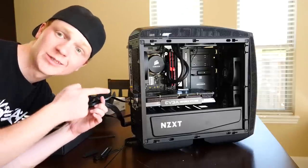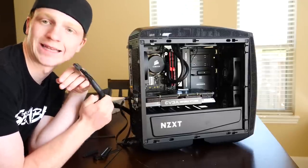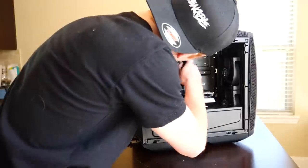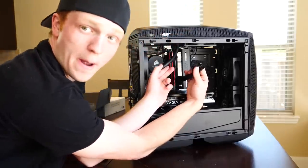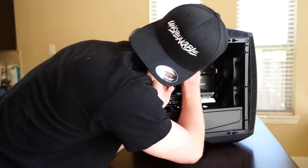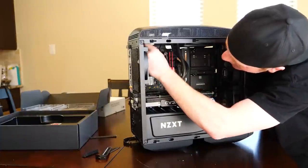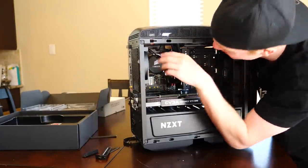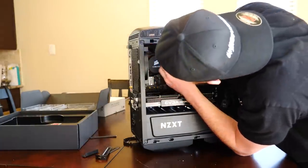Computer itself, all the components are in. All we gotta do is just wire everything. So, let's do that. I really don't wanna break anything. All right, this is the biggest wire of them all. It's the 24 pins. This powers pretty much the whole entire motherboard. This little guy coming up over here, over the hill, is the CPU power right here. This powers the CPU, the processor of the computer.